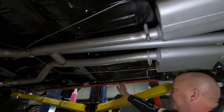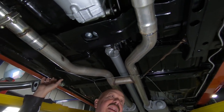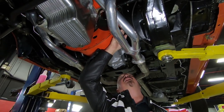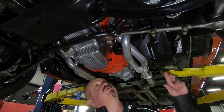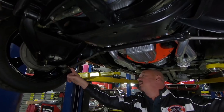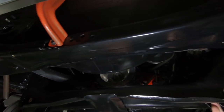The pinch weld looks good. The bottom side of the rockers are painted body color. Fuel filter is mounted right here in the center of the line. We've got new bushings on the subframe and it's all painted up. Cross members are all painted up. Explosion-proof bell housing holding this M21 four-speed Muncie trans up. It's got a stock-appearing mechanical clutch. Those are actually tri-Y headers — a tri-Y header setup that are jet coated. We've got what looks like new tie rod ends. There are disc brakes up front, new ball joints, and new bushings on the great big sway bar — it looks brand new. New bushings in the lower control arm.